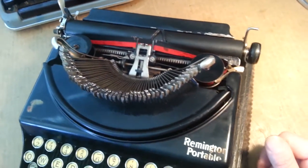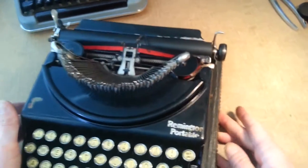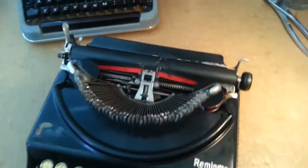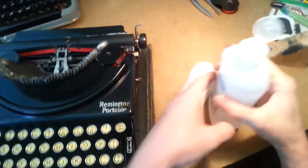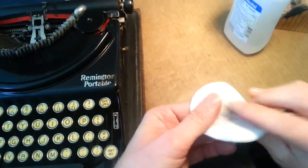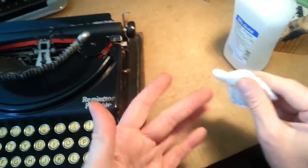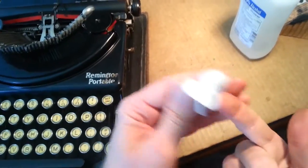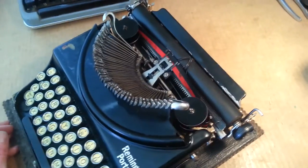That's really all there is to it. It sounds a lot harder than it really is — once you do it a time or two, there's nothing to it. Now the easiest and most fun part — it's a little bit rewarding. You've got all this ink on your fingers from doing a fresh ribbon. How do you get rid of that? Get a paper towel or cotton pad and some isopropyl alcohol — works like a charm. You don't want to get it on the platen because rubber and alcohol aren't friends, and on any paint finish you don't want too much alcohol either, since it is a solvent. But it will take that ink right off your fingers lickety-split. Do it quickly because this stuff does not come out of your clothes well, and you certainly don't want to track it all over your machine. There you go — fresh ribbon on your little Remington Portable.